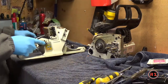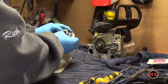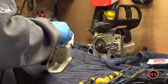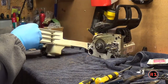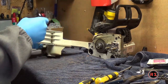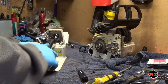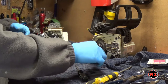I'm using my set of pliers to spin the line in the hole to make sure it's perfectly seated. Here I am installing a brand new carburetor — but at the end of the video you will see that this is actually the old carburetor installed on my chainsaw. I'll explain it later, but basically the new carburetor that came with the kit was not working. To reinstall the carburetor you need to move your way back from what you did when removing it — remove the top of the handle — because you won't be able to hook the throttle arm, and also the carburetor doesn't fit in the hole if the handle is there.